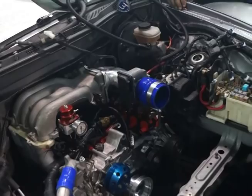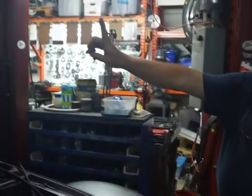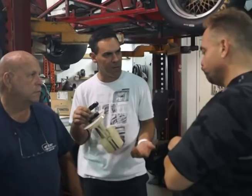Oh no, with a pump inside each tank? Yeah, inside, one on each saddle of the tank. The tank has that thing at the bottom that goes like that. You've got a saddle on this side and a saddle on that side. It only had one pump and a Mickey Mouse transfer thing, so we put a pump on each side. They both feed into a Y forward, and they both check valve, so it doesn't matter what side you're cornering on. It's technically impossible to lose.